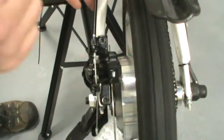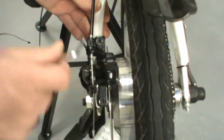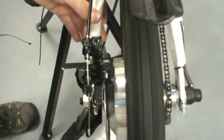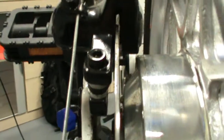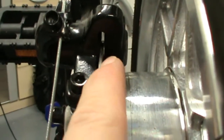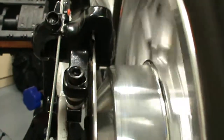That's tight now — no noise, that is perfect. I'm just going to check my bolts one last time to make sure I got everything. I'm not putting a lot of pressure on that — when it wants to stop, it'll stop. I can still see daylight down the side of the brake pads very faintly — just a little bit of daylight on the right-hand side of the rotor. My wheel is not dragging.